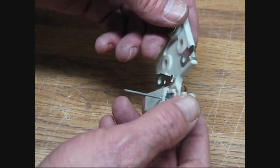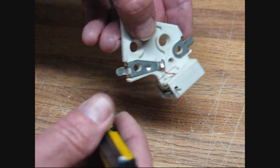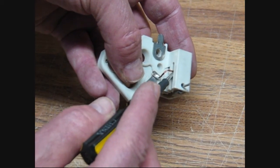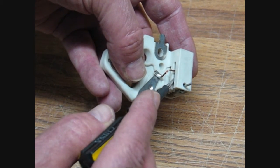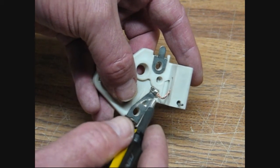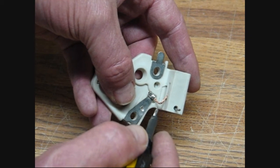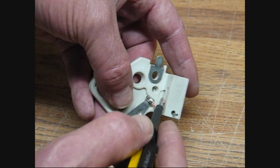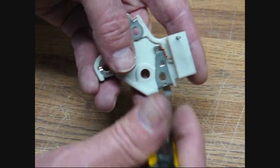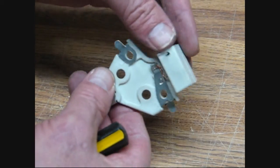Here's the last little detail on loading up these brushes that a lot of people don't go over — this is a tip from the Rebuilder, I've been in this a very long time. Once you get your brush holder loaded, inspect these little wires. Make sure the wire is in towards the proper position, so most of the brush sticks up to the top and the wire is down at the bottom. Also make sure that these wires are not pushed forward. If these wires are pushed forward and your rotor spins around close to this, as your brushes wear down and come out, that wire will hit your rotor's slip rings, cut that wire off, and your alternator will quit. So always make sure you push that wire back on both sides. Make sure those wires are pushed all the way down, and then you're all set to load this into your alternator and away you go.